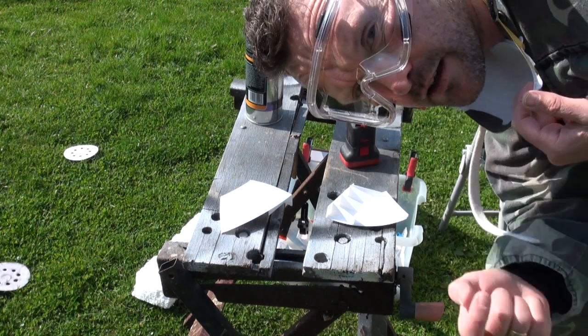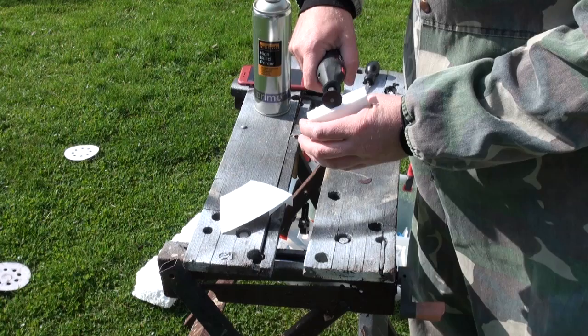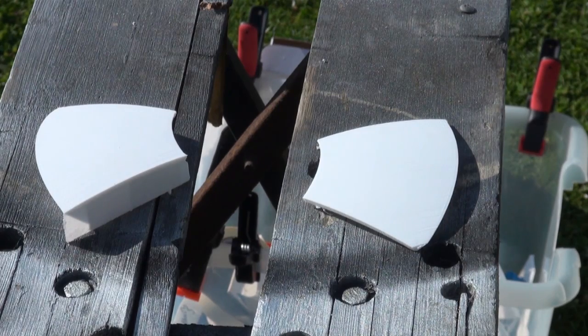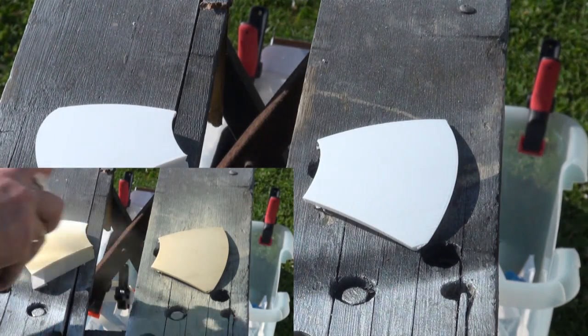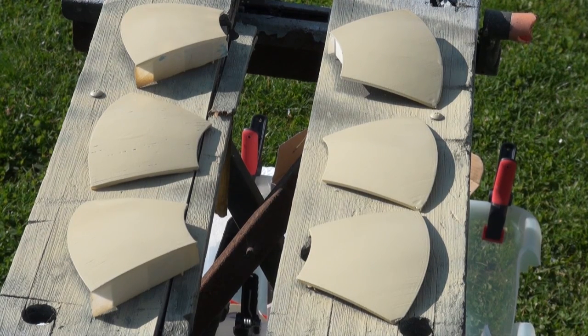That's why I wear these — and if I can, I highly recommend a pair of goggles and some eye protection of some form. I've been going over mine with a high-build primer just to fill in any of the ripples. There they are — first coat of filler primer, and then I'll try and give them another sand.